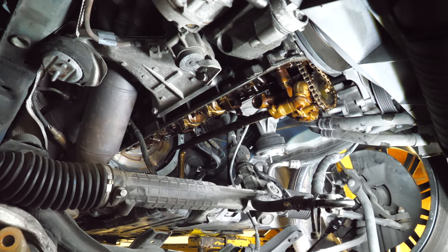Before I start going back together, we need to get these motor mounts off. Let's take a look at the motor mounts — this is the passenger side. Look how collapsed that is. Now these are the same mounts left and right. Here's my new ones — I bought some new mounts from 034 Motorsports. And even this one is collapsed, but this one is completely — look at that. That's why the sway bar was making contact with the oil pan. So we're going to get these new ones installed.